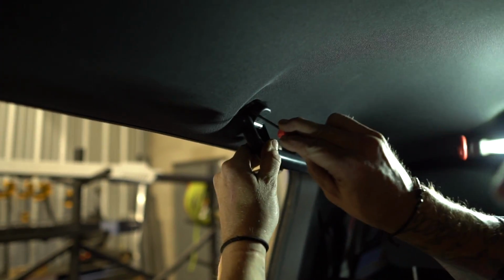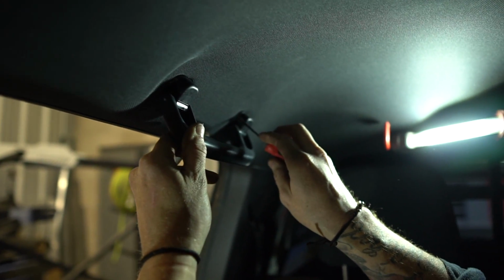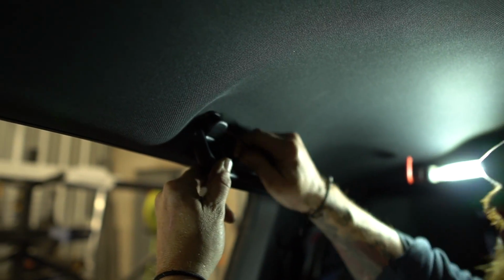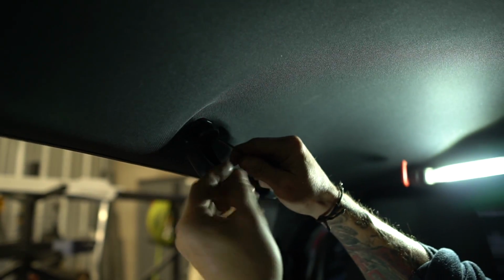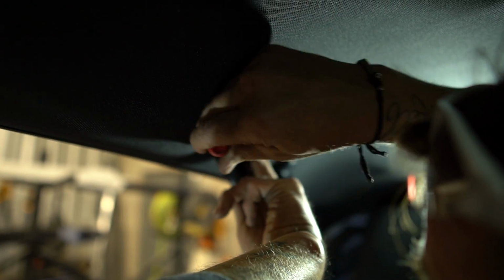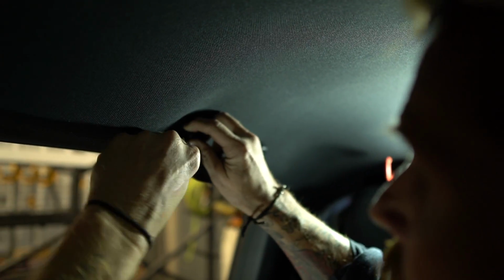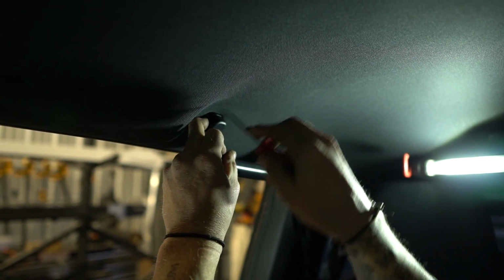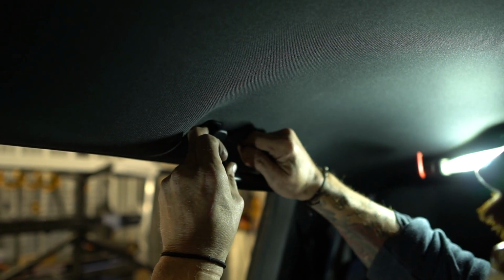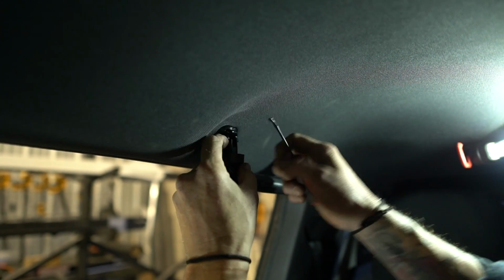on the side, right here and right here, and it may be a little more visible right there. See that little rectangular notch right there? If you get your tool in here, you can see it pop loose. Okay? One side. Get the other side going. The problem is when you pry against one, it wants to push the other one back in. So you kind of have to put your finger between them, and then you can get it loose enough. So once it's broken loose all the way across like that, it's ready to start coming out.